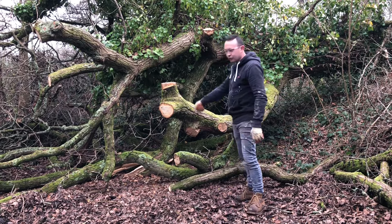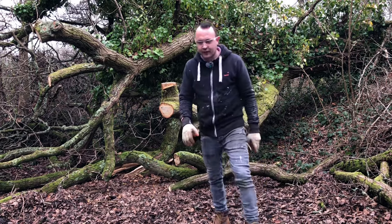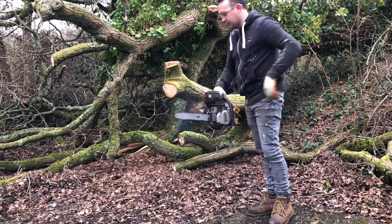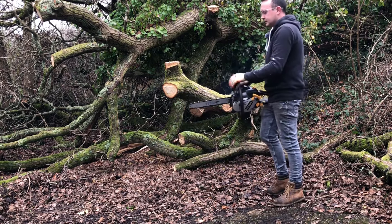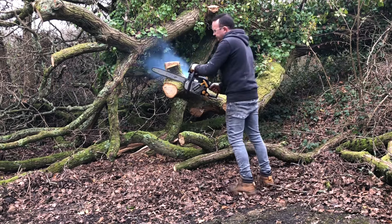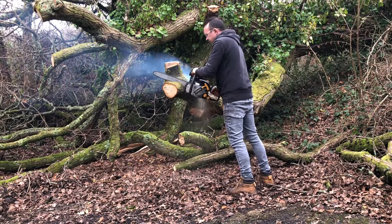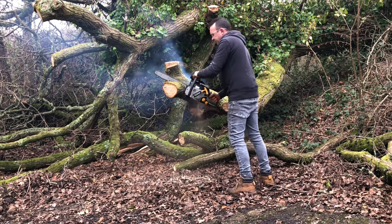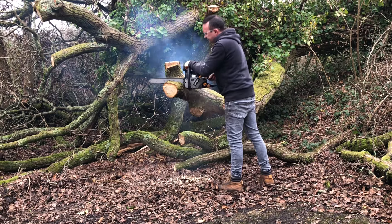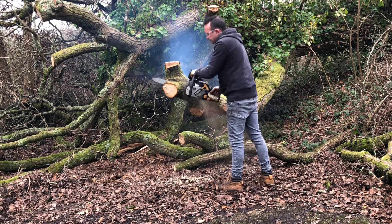This is pretty thick and damp — it fell down a month or two ago — so it'll be a good little test for that sharpen-up on that chain and a bit of footage of the sound of the saw when it's cutting. Gloves on at minimum safety, specs on — I always wear specs. I'm not a fan of wearing the helmet and visor unless I'm in amongst stuff near and above my head — that's when I'd use those. Right, let's get her fired up and get a bit of cutting done.